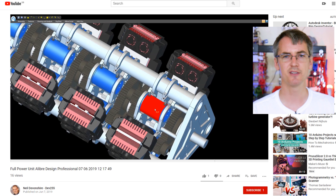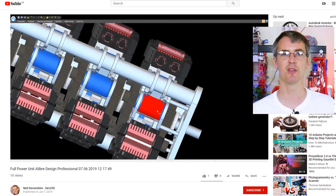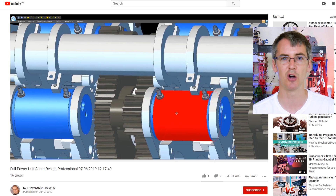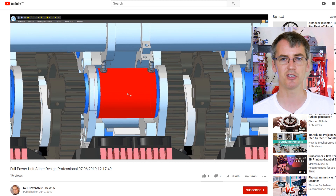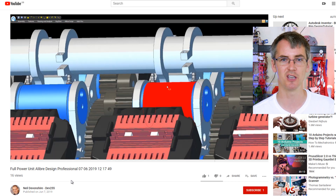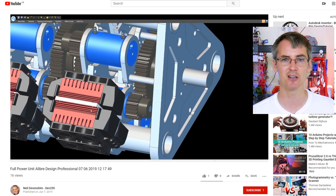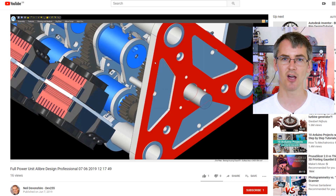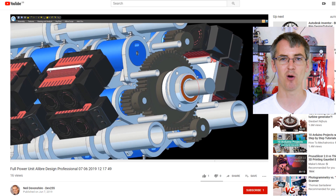It's Neil's electric car conversion concept. He's planning to put this as a replacement engine in an MGF whose engine has blown up. This unit will basically replace the engine and allow you to drive like a normal car but completely electric — around 100 horsepower, 0–7000 RPM like a normal engine. The key thing is that it's made of lots of small off-the-shelf electric motors, specifically radio-controlled boat motors because they're water cooled. There are four units, each basically 18 kilowatts, and each motor has a 200-amp ESC. All these motors work together, load sharing to deliver that power.